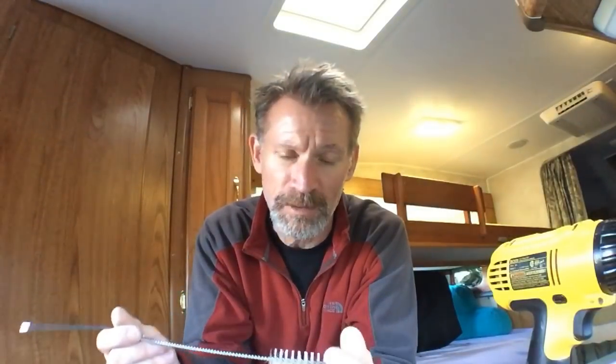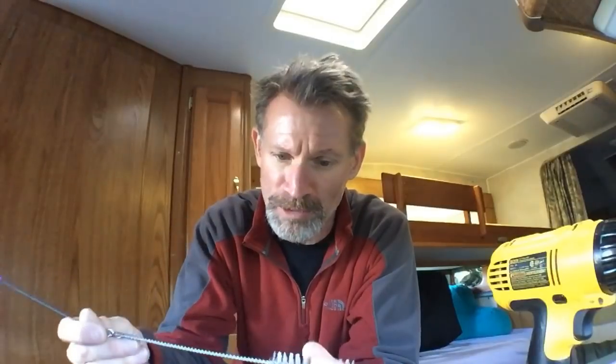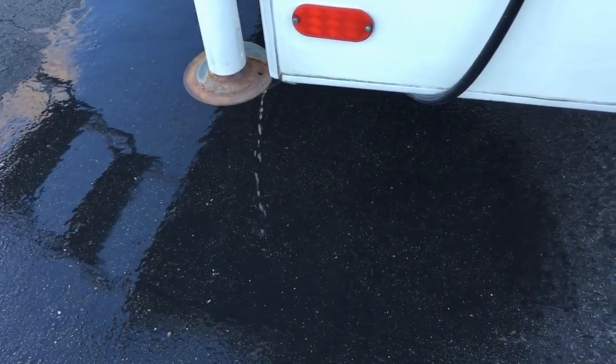A note about cleaning the hose from the tank to the pump using the little brush: in my case it's not going to work. My fresh water tank has a 90-degree nipple on the end and I can't get the brush through there. I could feed it from the pump side down, but I don't want to push more gunk into the fresh water tank. The hose looks clean anyway, so it's not necessary. It might work for others with a straight line coming out of their fresh water tank — you can ream that hose out with one of these brushes.